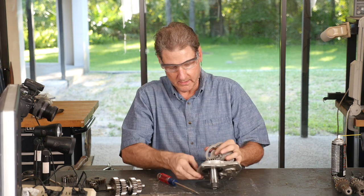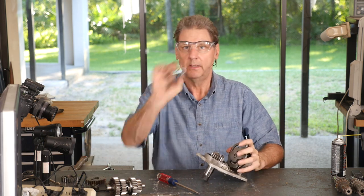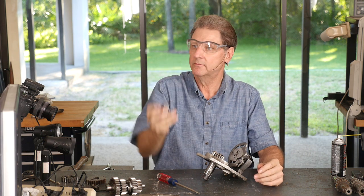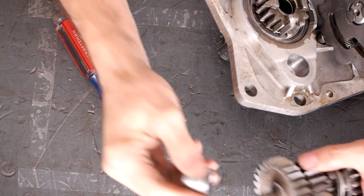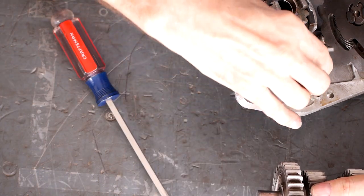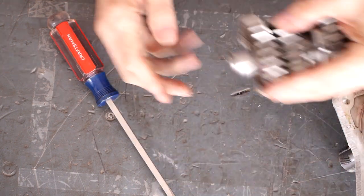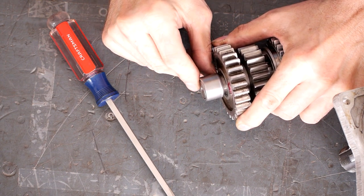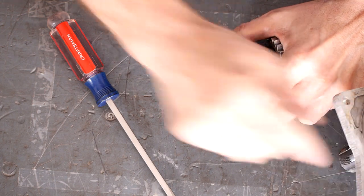Next, I've taken the countershaft bearing out. On the other side of the countershaft it's got a seal so oil doesn't leak out of the tranny, but this one's straight through and hollow. This goes right here in the trap door. You can have this bearing running quite far recessed into the trap door - almost an eighth of an inch. Make sure it's on a nice place of the shaft.